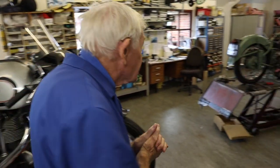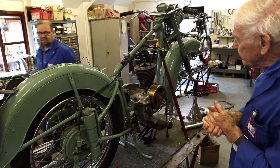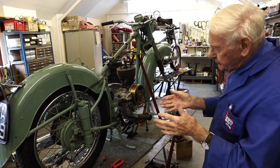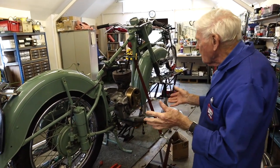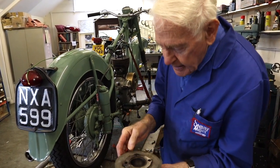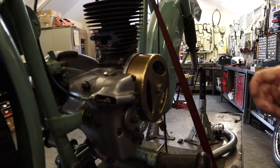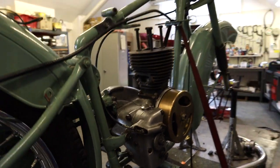We spoke about the Ambassador last time - quite a bit of progress. Steve's pulled it apart, I've sent off a lot of stuff for chroming. What we're doing is a good sort out and fettle, but it could do with a real strip down. We've too much on though, so we're aqua blasting the head, getting that all sharpened up. It's done a few miles, so we'll paint the barrel. The aluminium case has been sent off to get refurbished - it's all damaged.